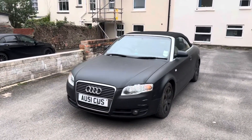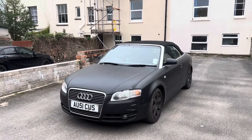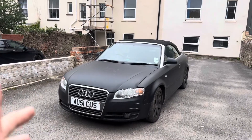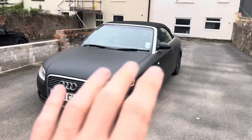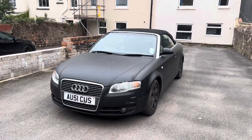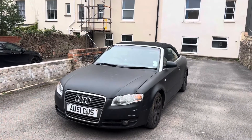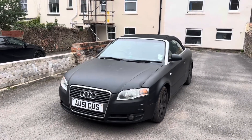In our particular case this Audi worked absolutely fine around town - there was no overheating problem at all. It was only when we went high speed on the motorway uphill and started putting excess load on the engine that the temperature gauge started creeping up, which is a sign that your radiator is failing. To get the temperature down you turn the heaters onto maximum and reduce speed. What we did is get a garage to change the radiator, and on the way home the car started massively overheating - engine coolant light on, oil light on, all sorts of things, because they hadn't bled the system properly.